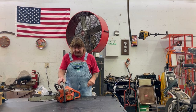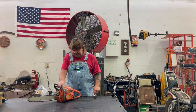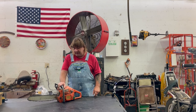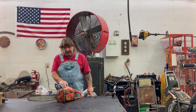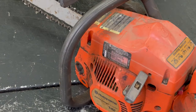Hi, I'm Mark from LM Small Engine. Today we're working on a Husqvarna 142 chainsaw. The piston scored in it — that either happens when you run it too lean, there's not enough oil in the gas, or sometimes they forget to put oil in the gas. Anyway, the piston scored, so we're gonna put a new cylinder and piston on this.